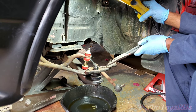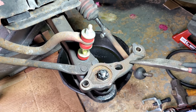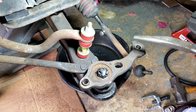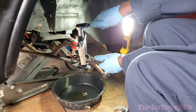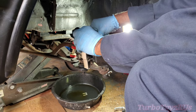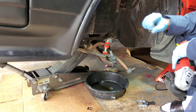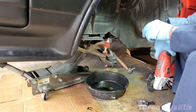This is a knuckle — this hole right here is the one that they widened; you have to oval-shape this. This is a stock AE86 knuckle that they converted to make the Celica RA64 or RA65 strut fit, and that's why I'm changing this out. Cotter pin, castle nut. While using the stock AE86 lower control arm, you're gonna need to modify it in order to use Technotoy Tuning's Big Daddy brake upgrade so it doesn't interfere with the rotor.